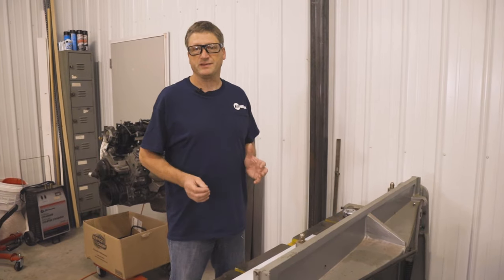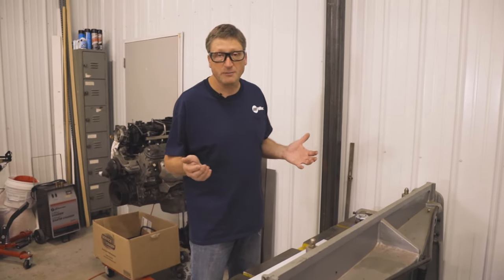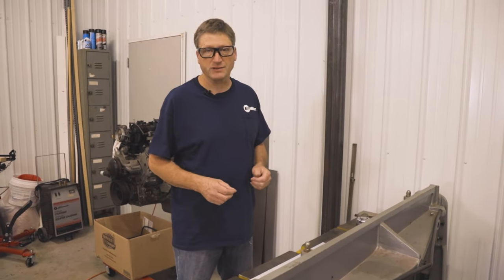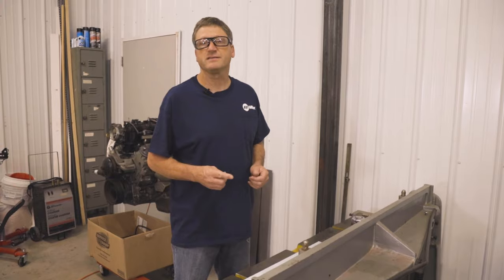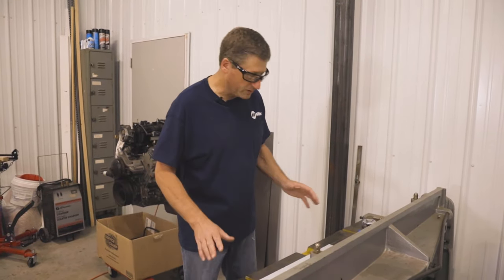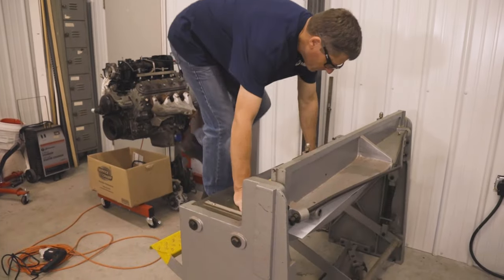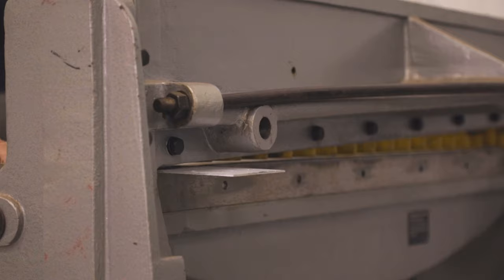Earlier, we mentioned that the shelf width was going to be 4 inches, but the lengths are going to be determined by the radiuses. So my top shelf is going to end up being 33 inches long. The next shelf is going to be 26, followed by a 16 inch shelf, and my smallest shelf is going to be 10 inches. So we're going to cut those right now.